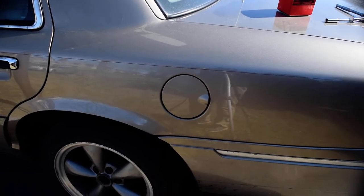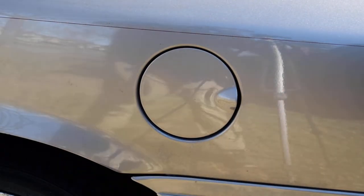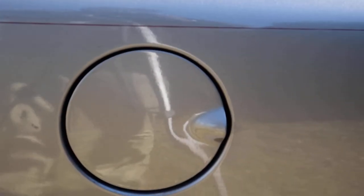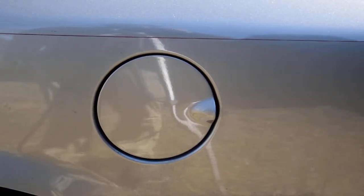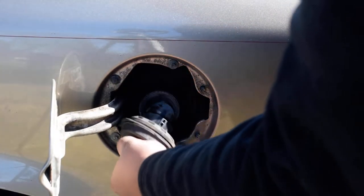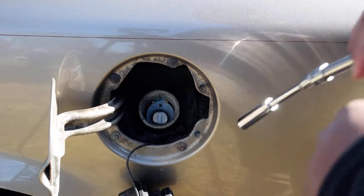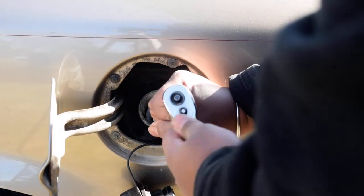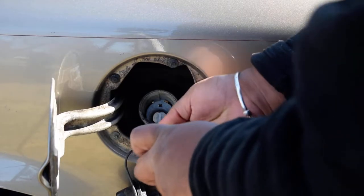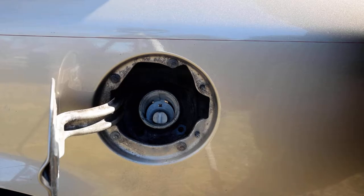Very first step — and also another reason: after 2002 they switched to just a regular door that anyone could walk up and pull open and twist off your cap. So, hopefully the wind doesn't kill it too much. First thing you're going to want to do: open it, remove the fuel cap. You'll notice there's a little holder on it. Grab a 10 millimeter socket on a ratchet, loosen it off, and slide it off of the screw. Set it aside and grab the new fuel cap.